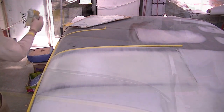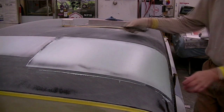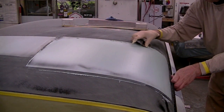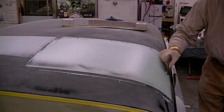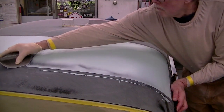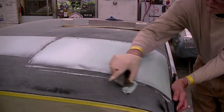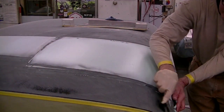Now I'm cleaning up the blade a little bit, removing the extra tape. Now I'm taking off the tape and I'm going to clean off any sort of overfill plastic filler used. I use a metal Bondo spreader that I've sharpened the edge to a half round circle. This cuts off the plastic filler that is partially hardened very easily and helps me keep the area that I'm working clean and free of any overfill.